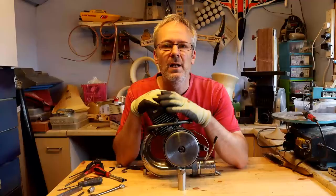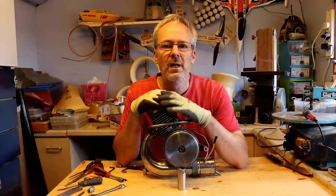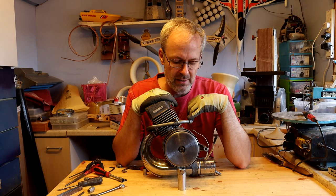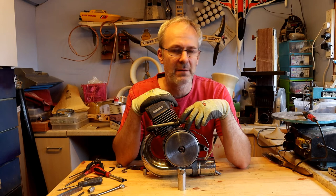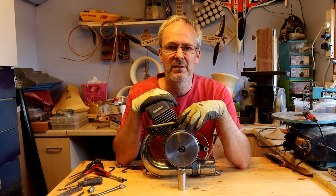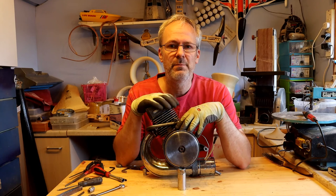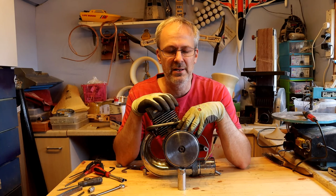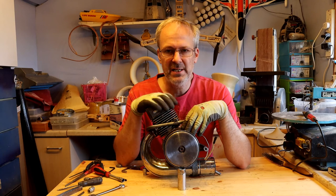So that's the engine fully rebuilt. The carburettor is still on the bike with all the cables still attached. The only thing I found wrong with this engine was the flywheel had slipped on the contact breaker cam, and that would have caused the magneto to be out of phase with the contact breaker — so I definitely wasn't getting the spark that I should have at the right point. So the next thing for me to do is put this back in the bike, connect up the carburettor, and see if it works. Thank you for watching — I've had two quite long videos, the strip-down and the rebuild. I hope you found them enjoyable and have learned something from them. Please subscribe because I will be doing some more videos about my little Mobylette X1.